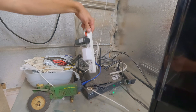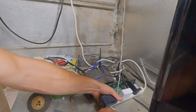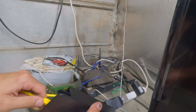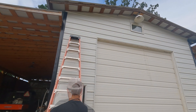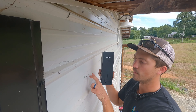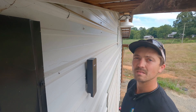Essentially I've got some power strips and we're going to plug our PoE into here. That'll give us power and then we will run this from our PoE port to the bridge. As y'all can see, we have power now. To mount my wireless bridge, I put a couple of screws here with the right spacing according to the back of this bridge. It's mounted and in place.